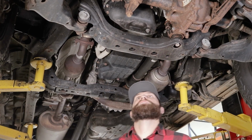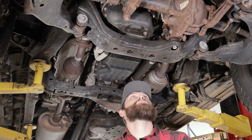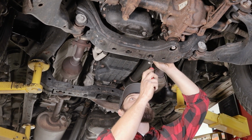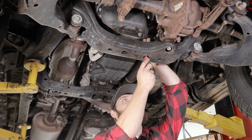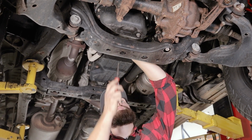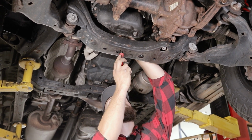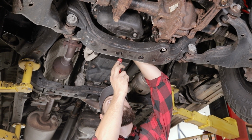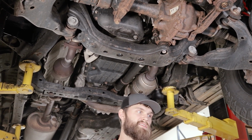And once you have your plates lined up, you can go ahead and drop the nuts in from the top. It's a little bit helpful to drop or push a screwdriver up from the bottom, and then you can just slip your nut right down on the screwdriver and easily line it up with the hole. Like so, and now you're ready to begin installing the front skid.